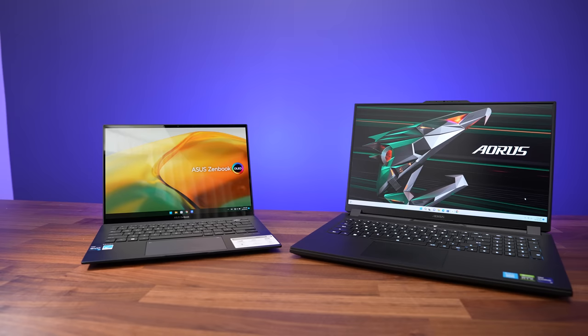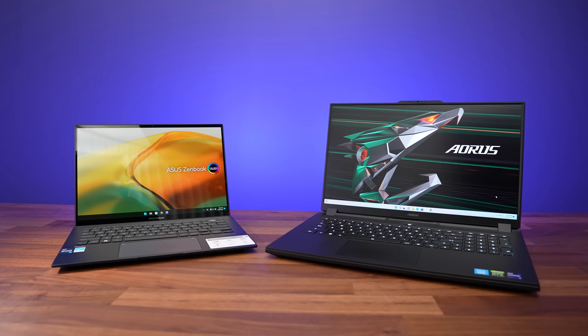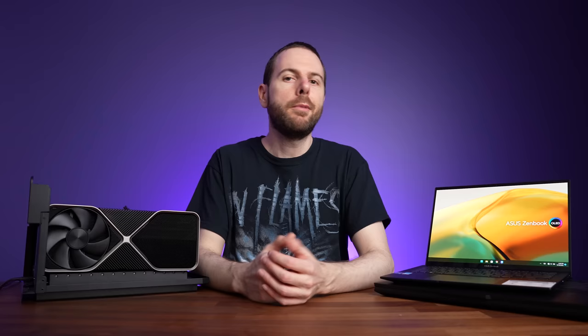I need to note that I'm testing with a monitor connected directly to the RTX 4090. If we were to test with the laptop screen instead, we'd expect even lower performance — both because we're using bandwidth to send the display signal back over the Type-C cable to the laptop, and because the laptop's GPU needs to process what it's receiving to show it on screen. Long story short, although the RTX 4090 is certainly powerful, it's going to be limited by Thunderbolt bandwidth and our laptop processors. So let's see what the differences are in 20 different games.